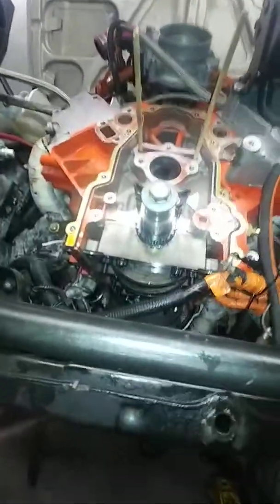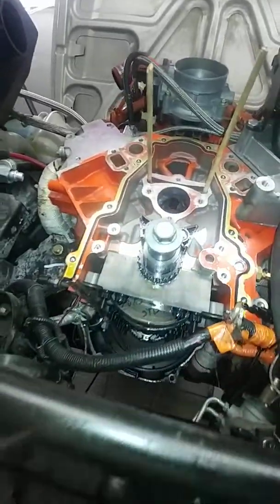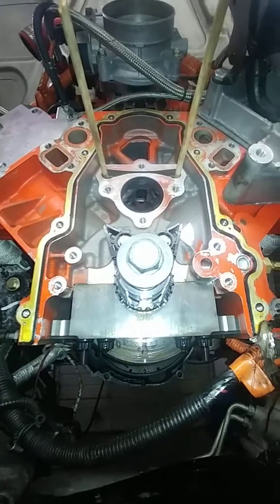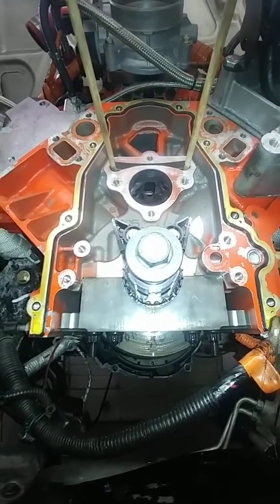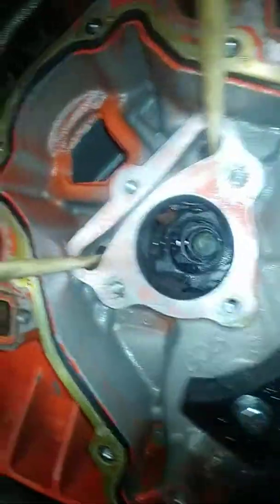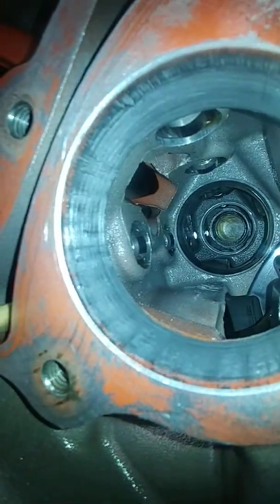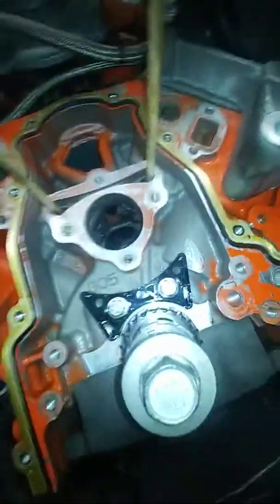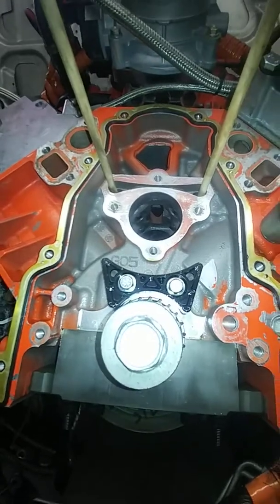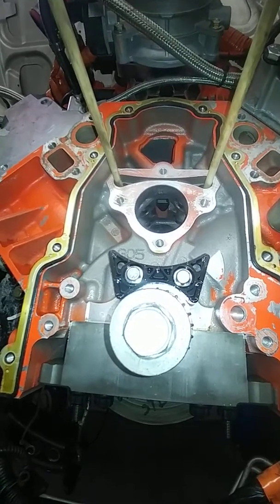But generally you're going to find it here — either the oil pump, the oil pump O-ring, or the cam bearings. In the next video, I will show you how to replace a cam bearing without removing the motor or the crankshaft or anything like that, just as it is right now. I've already removed the two cam bearings — the front one and the number two one that moved back — and I'll show a quick video of how to put the new bearings in. A little myth-buster video, because people say you cannot do it without removing the motor, but it's not true.